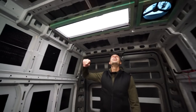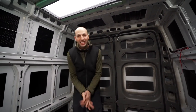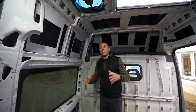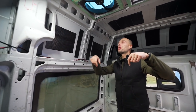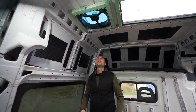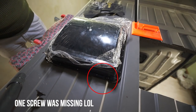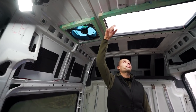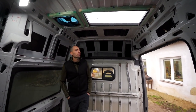This seems to be pretty good. First testing — water sits on the top, in the corners down here. We actually had a leak the first day when a layer of snow dropped on top, and I came in the morning and saw a little puddle. I thought it was the windows because these are screwed to the car — I expected those to be least likely to have a problem. But I took a look and found I'd forgotten to screw in one of the screws through the hole, so there was a literal hole where I forgot to screw it in. Just put a blob over the top and now it seems perfect. No leaks. We'll see how this performs long term — I'm a believer in developing, and I bet we'll sort out a better solution if this doesn't work out.